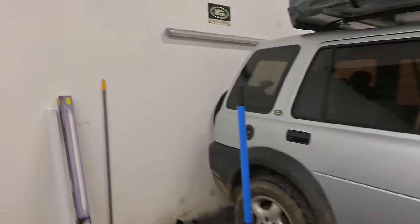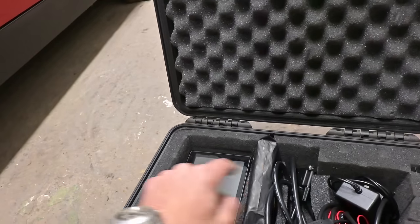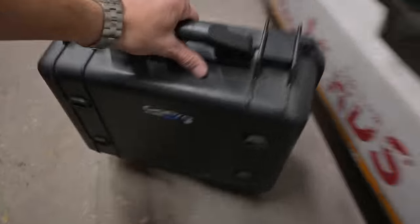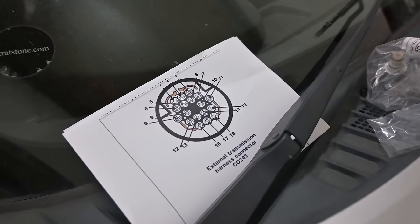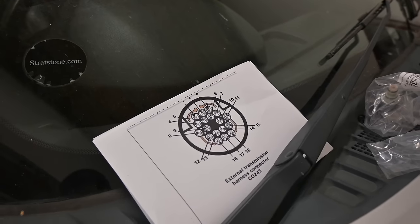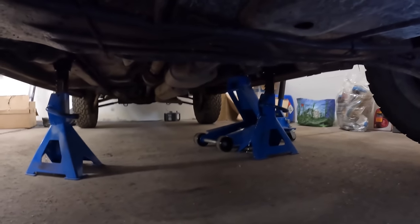First thing I'm going to do - I've already checked on the P-scan, which is a tiny black box containing a Raspberry Pi and a load of cables. It's identified the fault. I'll confirm the fault by locating a connector block under the bonnet and checking the ohmmeter on what they're doing, just before I start emptying oil out, to make sure we're doing the right stuff.